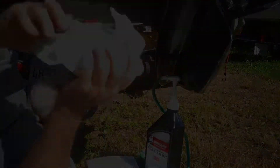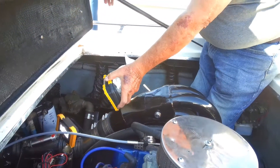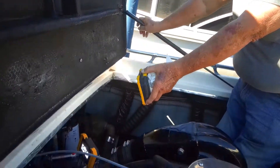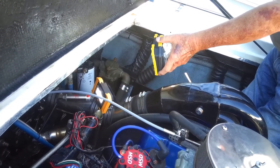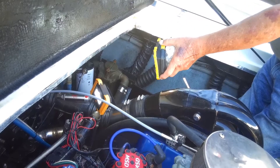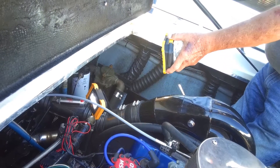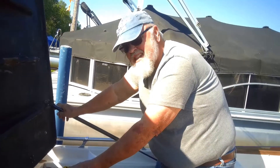Let's go on the boat. What I've done is poured oil in this dipstick right here. What you've got to do on this motor is the drive has to be tucked in, and you pour oil into this reservoir and it goes into the top of the outdrive. When I pop this in the water and start it, after it idles for a bit, I need to recheck it and see if I need to top off the oil. But that's basically the way of checking the oil on this outdrive — messy process. Okay, we're through with the outdrive. I hope you enjoyed this little short video. If you did, please like and subscribe. Thanks for watching.